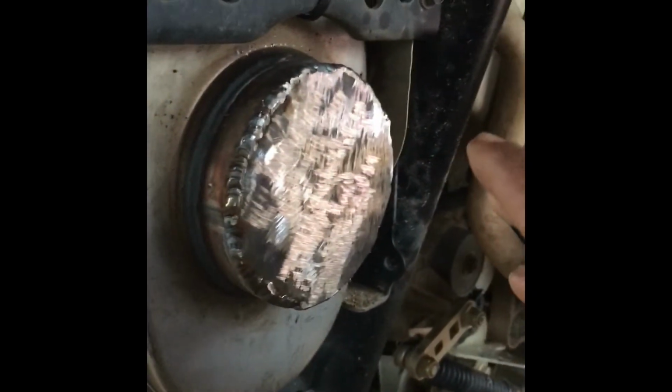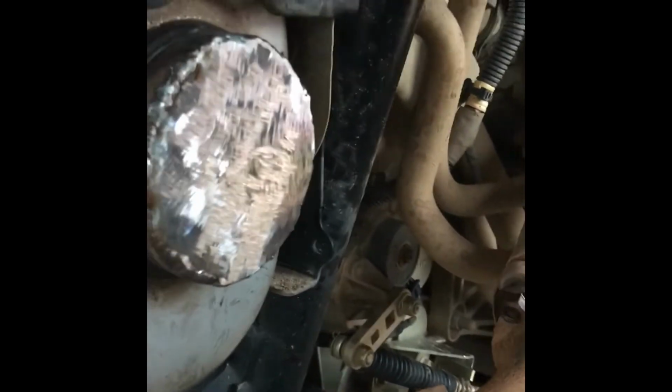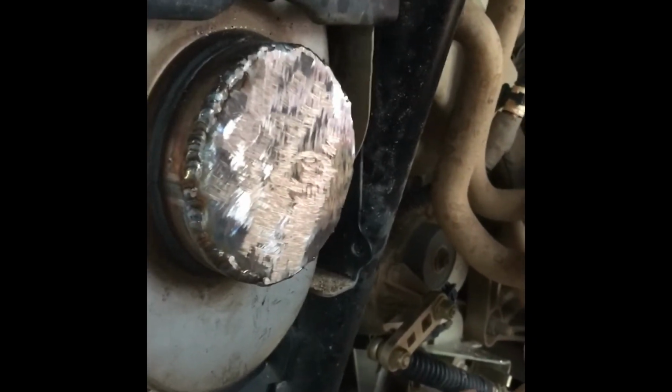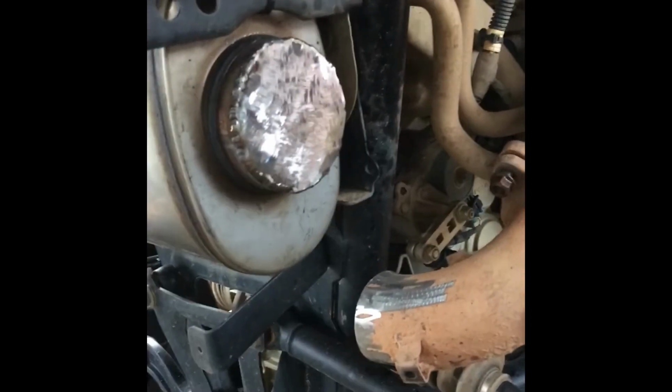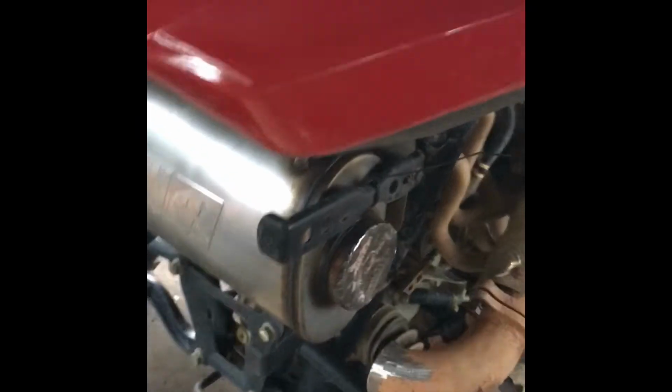All right, y'all, got the plate welded into place. It's nice and sealed, so I'm finna go ahead and put 3 bolts right here and tighten them up a little bit, and go ahead and run my Sharpie around where I can cut the hole out with the plasma cutter. Y'all know I'm working by myself, so I don't have nothing to hold it while I tighten up on everything. But yeah, that's what's going on.